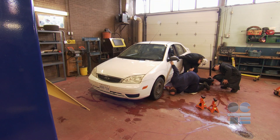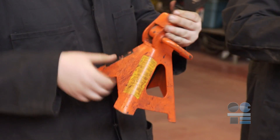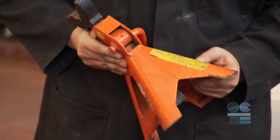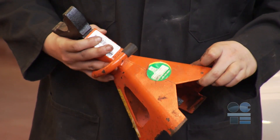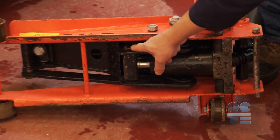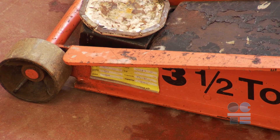Make sure your head is clear to operate and personal devices or peers will not distract you. Before you start, inspect the stands — look at the teeth and feet and see that the seams are intact with no splits. You're counting on them to hold a lot of weight and not slip or break when used. With the jack, check there are no leaks of hydraulic fluid and that the clips and pins are all secure and functional. It should also have a recent inspection sticker.